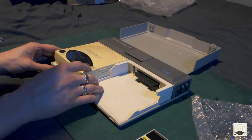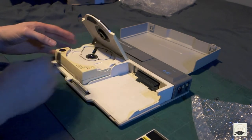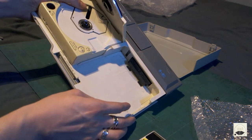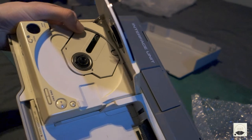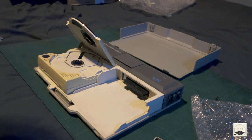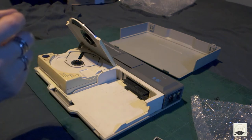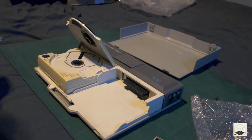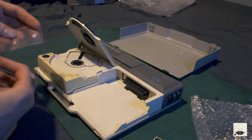As I said before, the problem is that the CDs do not spin. So the laser seems to be stuck right at the top, which is what I've been looking at on the internet — if you turn this unit on and there's a whirring noise but the CD doesn't spin, it means the middle gear. There are three gears in the lens array and the middle one is made out of really crappy plastic. I managed to buy two replacement gears off eBay.